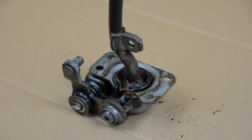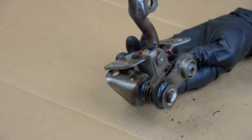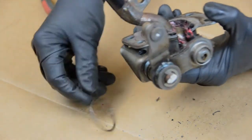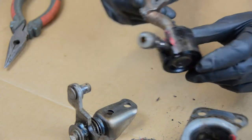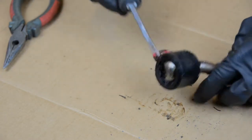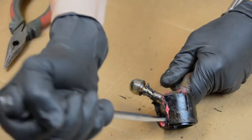With the shift linkage assembly out of the base bracket, we're going to take it apart and replace that cup. There's a little circlip - or whatever it's called - just a little clip that holds it all together. Get that out of there - it just sort of pops out and you weasel that off the shifter. From there it's pretty easy. This is a different piece - that just comes right off, and then that just comes right out. So there are all your separate pieces - this is the shift cup. Now we've got to get the shifter base cup off. This can be a little bit of a challenge. Get a screwdriver underneath like that, you can usually just pull it off the bottom. They're pretty tight - there she goes.